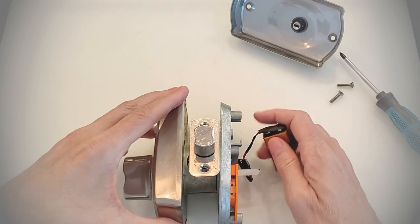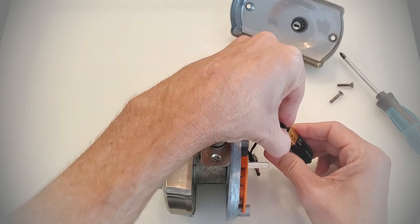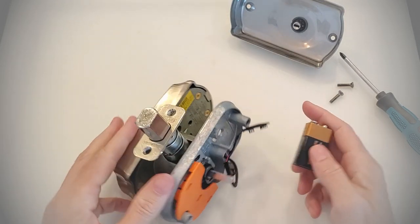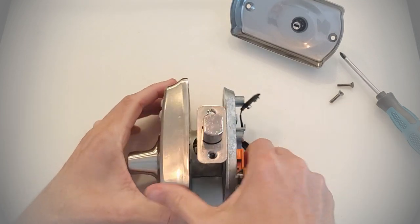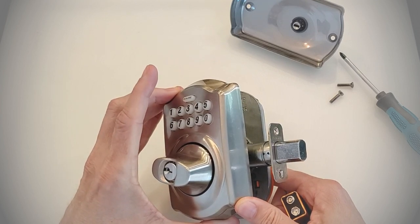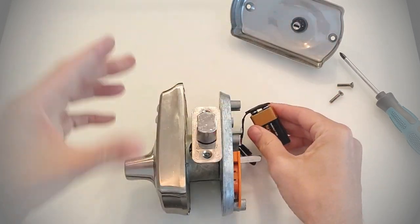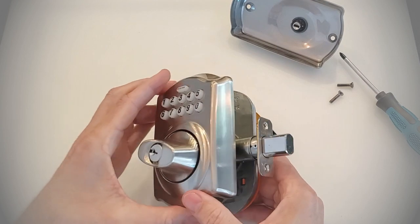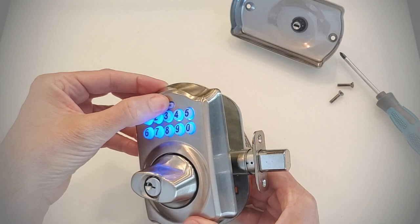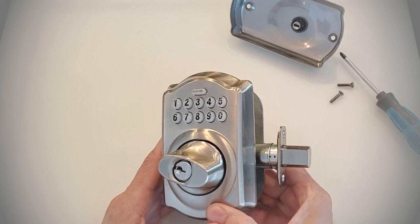Let's pull this battery out. Step one: disconnect the battery. Press the Schlage button on the front of the lock and reconnect the battery, then press and hold the Schlage button until it lights green and the lock beeps. At that point, I should have factory reset this lock.